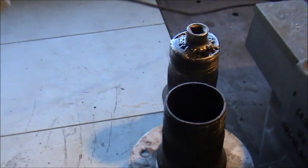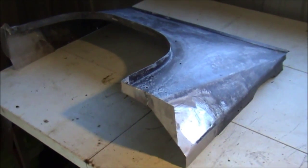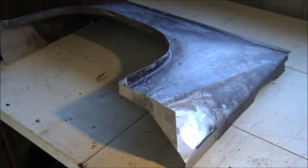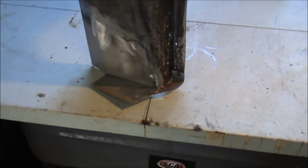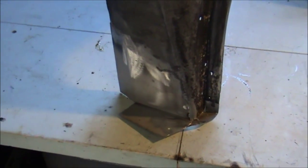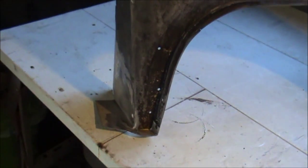I've done a little bit of welding on this piece here which goes over the firewall and fits over the gearbox housing which I welded up in the last video. The base of this was pretty well gone so I cut and made some new pieces which have been welded in. This will be painted and then it's covered with carpet so you don't really see any of it, but it's necessary probably for sound deadening and all sorts of other stuff.